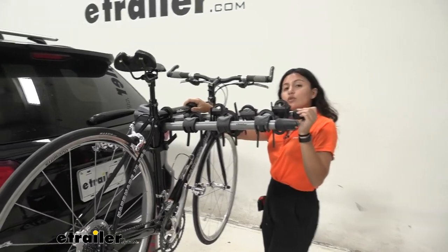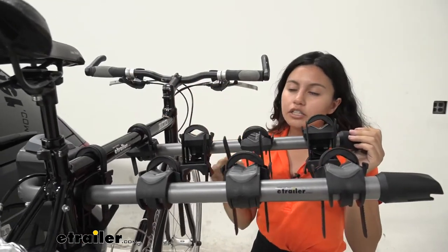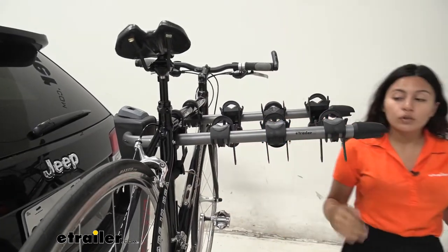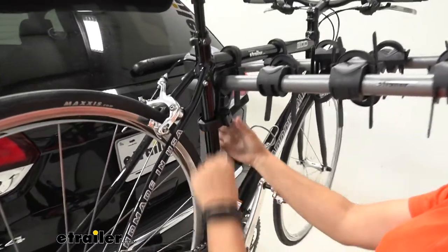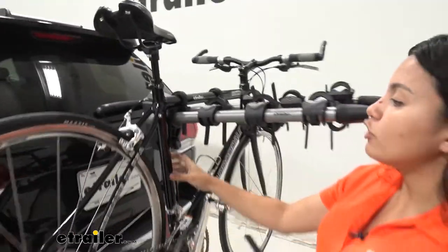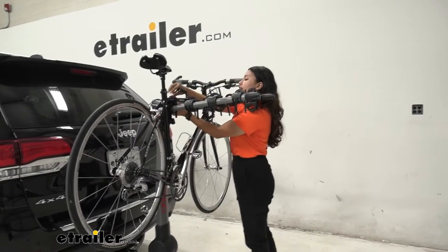First let's take a look at the way our bike is mounted. We have one, two mounting points on our top tube, and a third mounting point which is our anti-sway. When you want to take your bike off, notice the sway with that anti-sway zip strip mounted — press those levers, pull that zip strip out, and you can see the huge difference in sway with it disengaged.